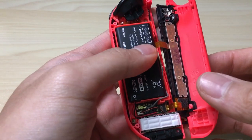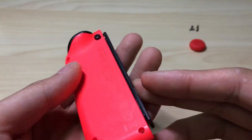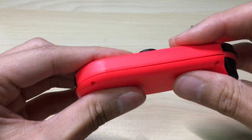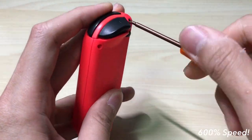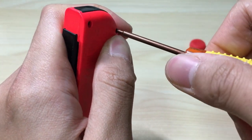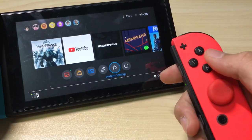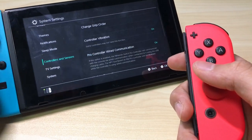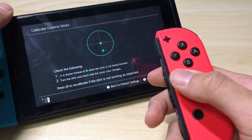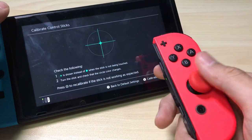See if it's working — press a button and the lights will go up. To put the shell back on, align the side tabs first, then press the other side and screw them back in. Now we've got our brand new joystick ready to calibrate. Go to System Settings, go to Controllers and Sensors, then go to Calibrate Control Sticks. Press in the stick and see — it's very responsive and very new right now. Let's calibrate it. When it says calibration is complete, you're done.